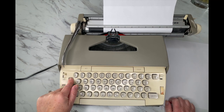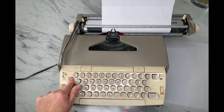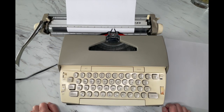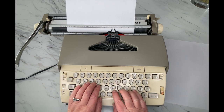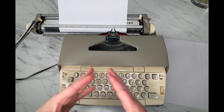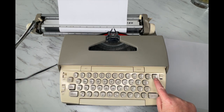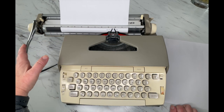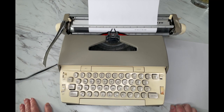Over here is your backspace. Backspace does not erase — it only moves back so you can type over your mistakes. Now there's that bell telling me I'm at the end of my margin. Once it stops typing, I'm going to hit MR on the right side for margin release. That's how you finish your thought or sentence. Margin release is not meant to be used at every line — set your margin to where you truly want it to end; it's just for occasional use.